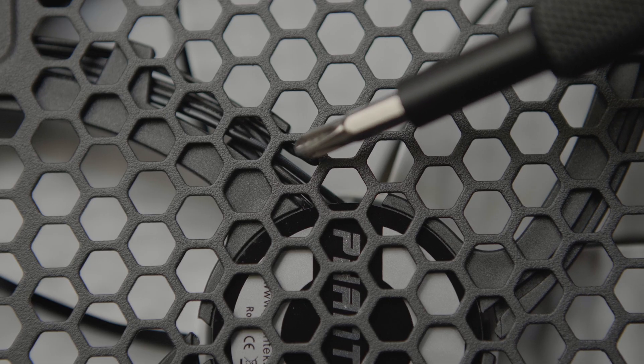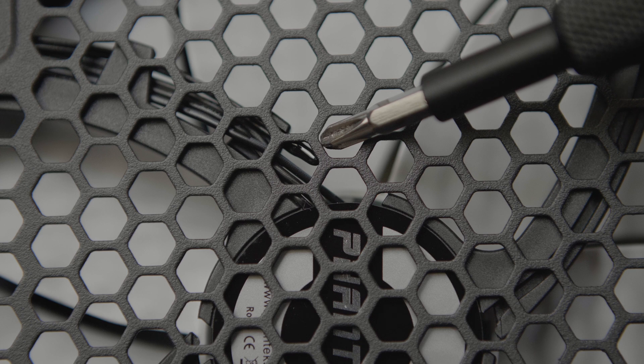There's one thing I did that you may consider doing in your build. This motherboard comes with thermal probes and a header for them. What I did is route the thermal probe through the exit of the fan so it captures the temperature of the heat coming into the case. I dialed in and mapped the temperature probe based on the temperature within the case. This means when the CPU is idling and not putting out a lot of heat, the fans will be running at their minimum speed, and when it starts generating a lot of heat, the fans will ramp up. As a result, this cuts down on a lot of dust buildup over time because the fans are not running at near maximum speed.